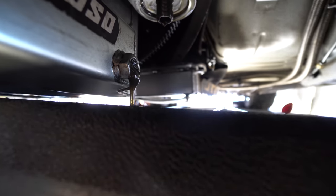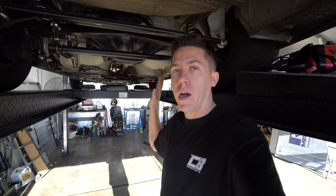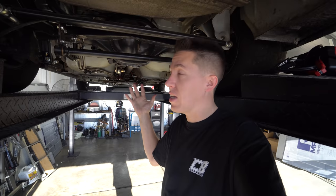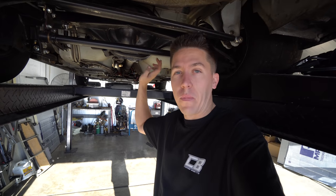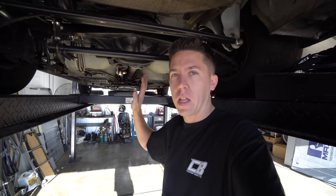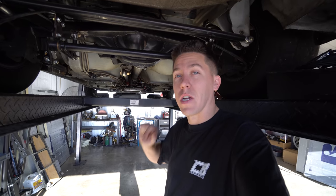The third thing I hate about the Camaro is that it has a 3.90 rear gear. I liked it a lot for eighth-mile no-prep style stuff, but now that we're starting to do more street car stuff and I'd like to take it on Race Week, it makes it difficult to do more than about 60-65 mph on the highway. So that's going to be changed — probably going to a 3.50 or 3.25, most likely a 3.50 because that's what's perfect for quarter-mile stuff.